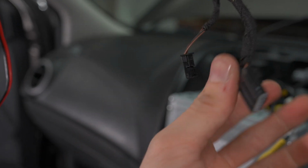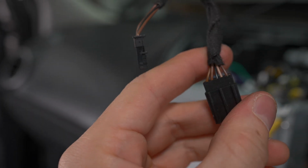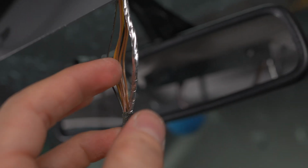All of those colours that weren't in the alfoil, we can locate here at one of the two plugs. So we know that within the alfoil is the white with a green stripe and the brown with a purple stripe, because every other colour is present there.